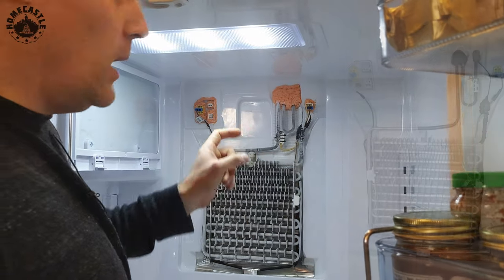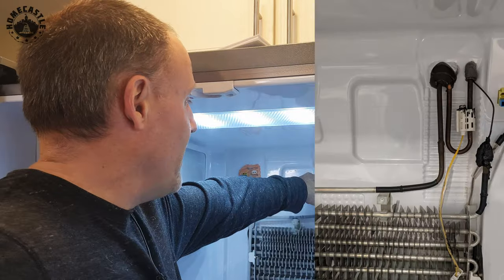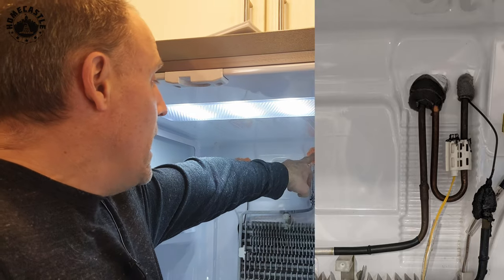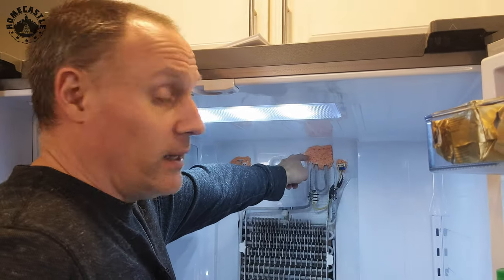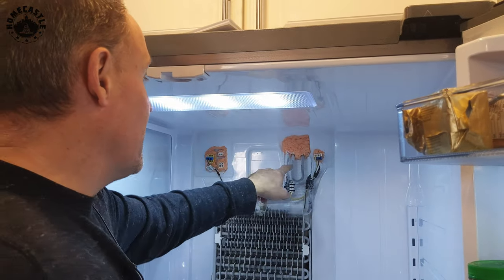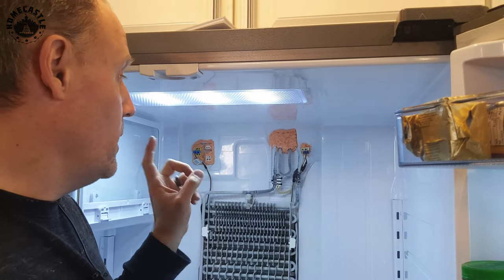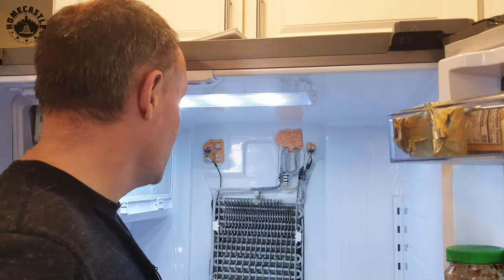The second thing you need to do, in addition to the changes made to the cover, is remove the factory weatherstripping from around this penetration — there's none at all around the electrical connectors. Then use spray-can polyurethane foam to fill in the void. Step one: remove all the factory foam. Step two: insert foam of your own. This will prevent moisture from coming into the unit and causing that ice buildup. Foam this area, foam this area, foam this area.